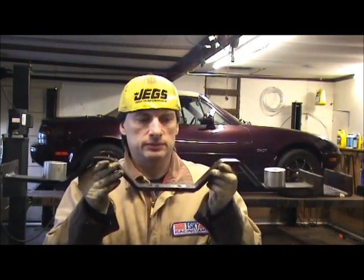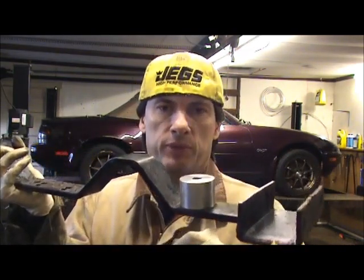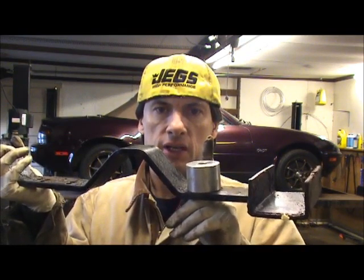Like I said, the bolts go all the way up through, right to the inside of the car where I have these plates TIG welded to the inside of the car. Under the carpet, the plates are big plates, and half-inch bolts go through those, and it supports the transmission mount. So that's one of the modifications that I did, one of many modifications.